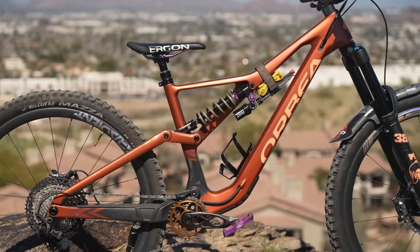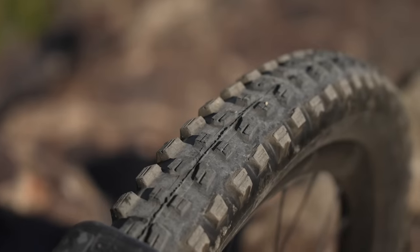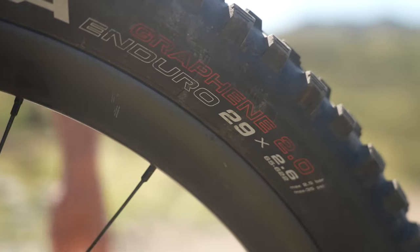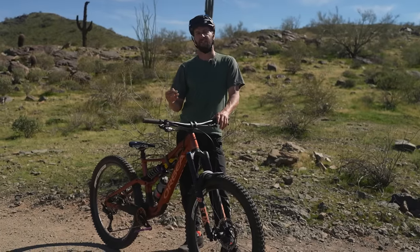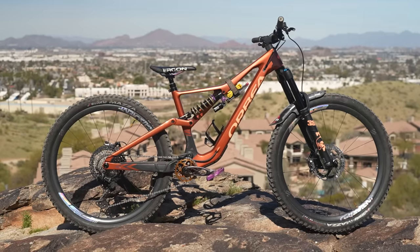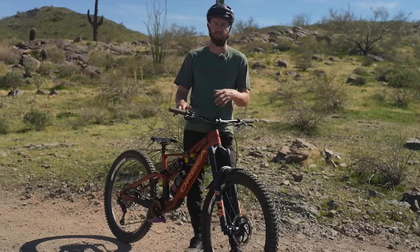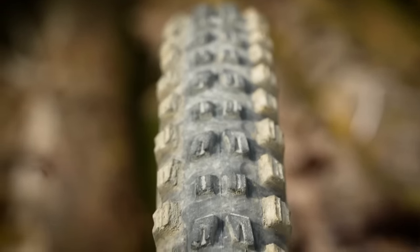Onto wheels and tires — one of the most important setup aspects of an enduro bike. Starting with tires: 2.6 up the front, 2.4 at the back. Anything within that width range is going to be bang on — I myself run a 2.6 up front and a 2.4 at the back. While I'm at it, I'm running enduro casings. These are virtually some of the thickest, toughest casings you can get, because you are pushing this bike to its limits on what are essentially downhill tracks. You need solid rubber underneath you and a tire you can trust — the sidewall's not going to split, tear, or knob off.